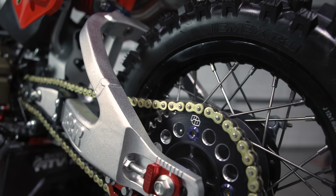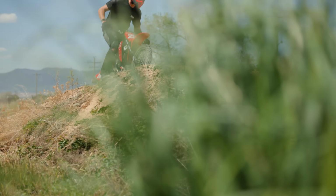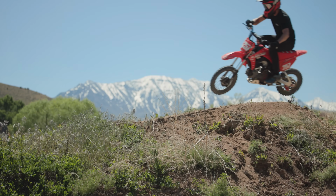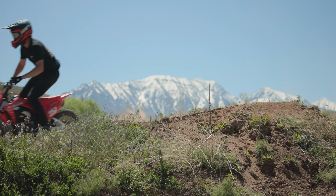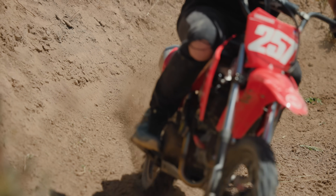So let's talk about the hoops first. These are aluminum, which is not only lighter than your stock steel hoops, but they're also stronger. It's 7000 series aluminum, and that is taking away unsprung weight for this bike. So it's gonna make that more flickable, it's gonna make your ride better, but it's also cool that you're bulletproofing your wheels. With the spokes, these things are heavier duty than your stock ones.